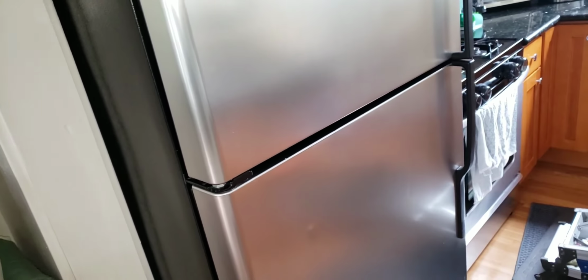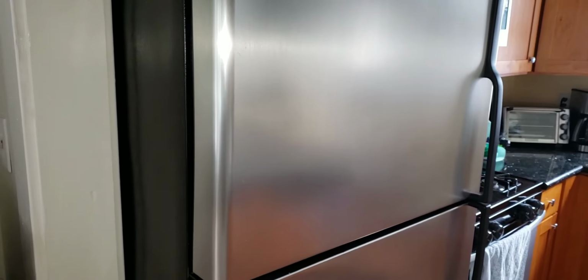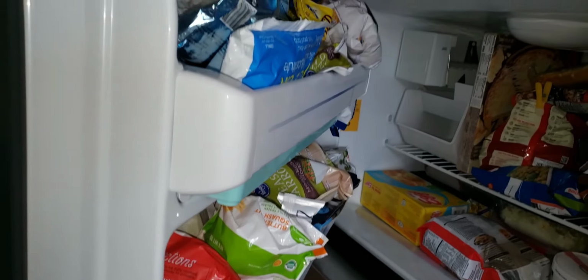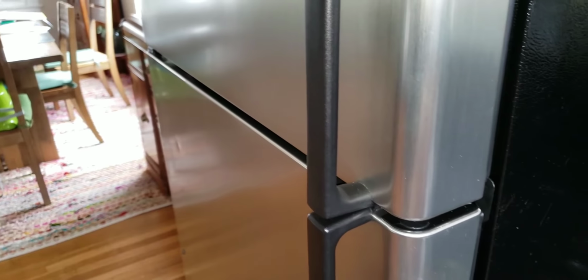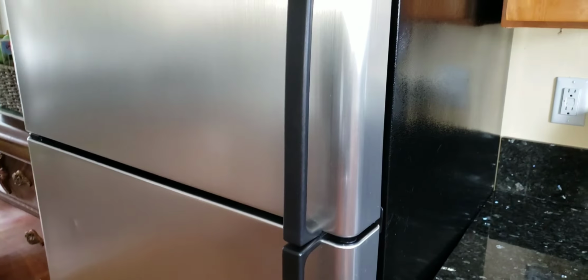Repair conclusion on GE refrigerator. GE refrigerator complaint, making noise. Found problem in the ambient air door seal gasket and food quantity. The door is not shutting all the way, allowing ambient air into the refrigerator, icing up the back panel and causing ice crystals to form onto the evaporator fan.